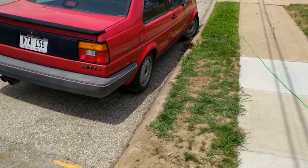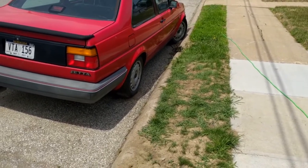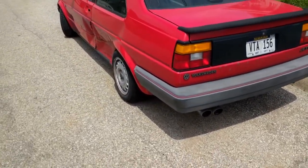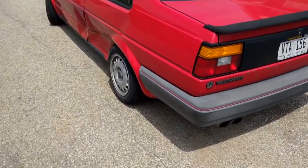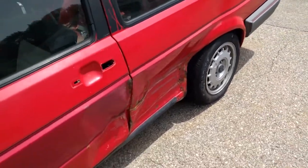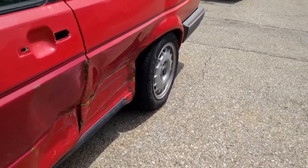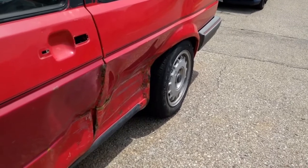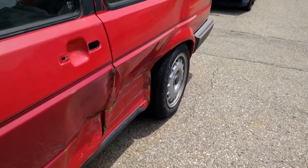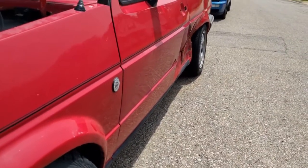Part two. That's the passenger side. That's what it's supposed to look like. Much better. They're all four pointing the same directions now, but you can see just how far in things got pushed, because that tire used to fit inside that bent part. So that axle had a severe twist to it. Much, much better. But that's a long way sticking out.